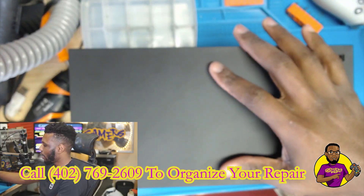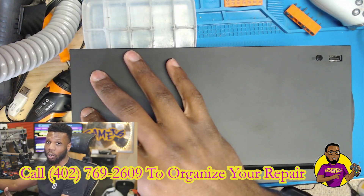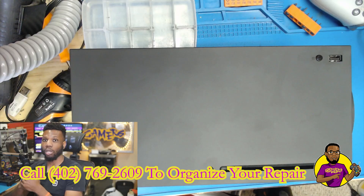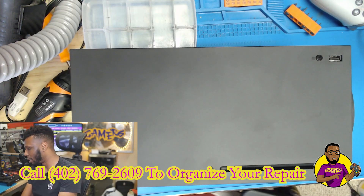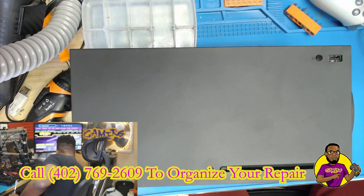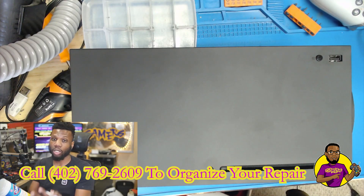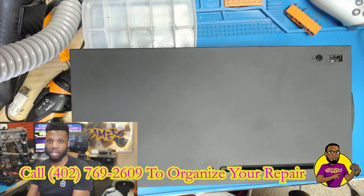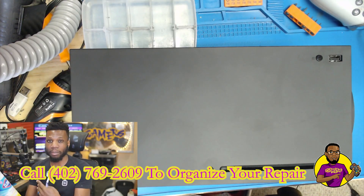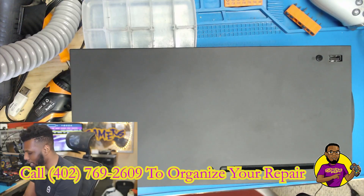If you don't know how to take apart the Xbox Series X, you can watch my disassembly video or any disassembly video where they take it down to the main board and the APU. We're going to apply some thermal compound and also clean everything. People always ask me what the best things to clean with are — a toothbrush, Clorox wipes, and an air compressor or can of compressed air to dust everything out, because a lot of dust builds up inside the heat sinks and stops airflow to the processor, which can also cause overheating.